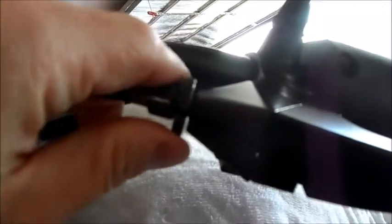Next thing you're going to do is take off the clutch lever, at least the wire here. So what you got here is a little jam nut, and it's almost down all the way, but you're going to loosen that all the way. Then you're going to screw this in all the way, give you as much slack as you can. You can go on the motor side and get more slack, but there's a little trick here. So I'm going to line that up and line that up.